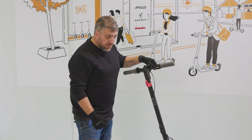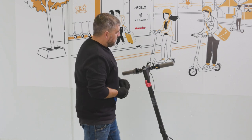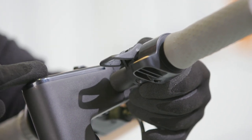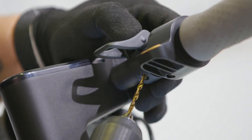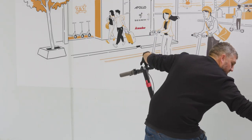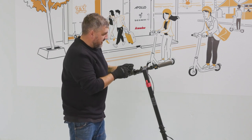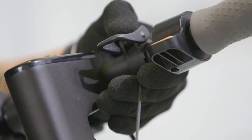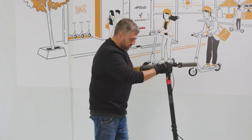The last step is, because we've changed the geometry on the scooter, getting the carry clip to work. All you need to do is pull the screw out and twist the clip as high as you possibly can, then redrill another hole. Now that's drilled, put the screw back in the new hole that's been drilled, and that's it — that will catch the new clip.